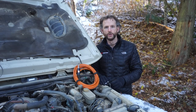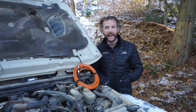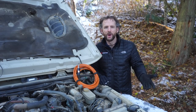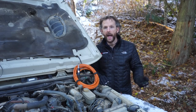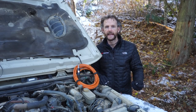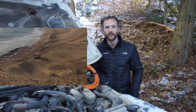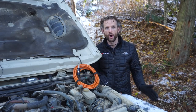One of the greatest ways we can reduce wear and tear on our vehicle and increase tyre life is to air down our tyres when the going gets rough. If I'm on a rough gravel road and I know it's only going to be half an hour, sometimes I'm lazy and don't air down, but when I know it's going to be hours and hours or days and days, absolutely — I get out and air down all my tyres. Usually I go down to around 24 psi. My Jeep's pretty heavy, so I don't go really low unless I'm seriously off-roading in low range, then maybe 18 psi, or on deep sand in Namibia and South Africa I'd go down to about 10 psi. At that, I have to be careful not to pull the tyres off the beads of the rim.